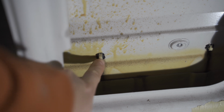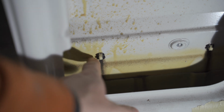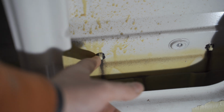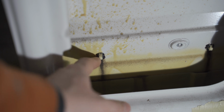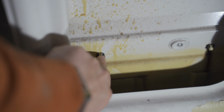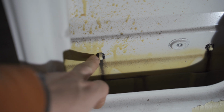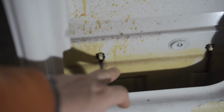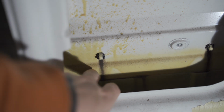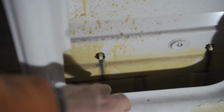So that's the fixing clips from the inside view. We applied Sikaflex on the outside all around the bead, and you can see after pressing it in, Sikaflex came through the hole, sort of filling up the clip middle, because it had a little cavity in there. So we did go over with an excessive amount of it, but personally I just don't want it to leak in at all.